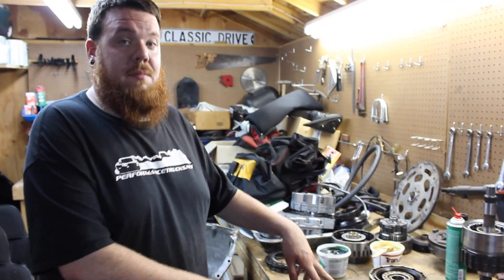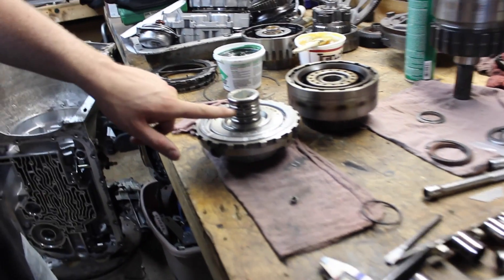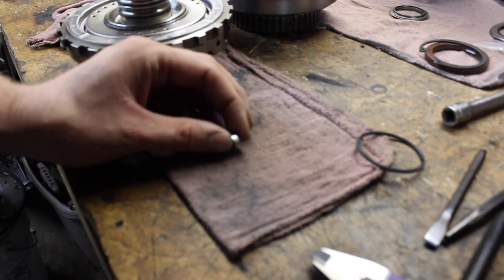Obviously this is after you want to disassemble your transmission. You've cleaned everything and you've replaced the lip seals and the intermediate piston and all that inside of here. So basically once you've left your center support second sealing ring off the center support, you want to move down to plug the case in the actual transmission itself.